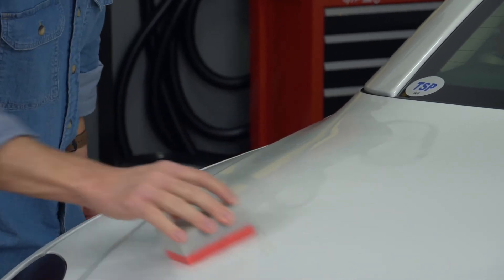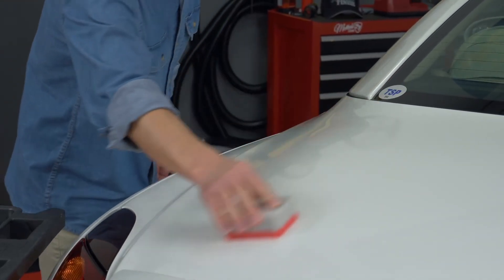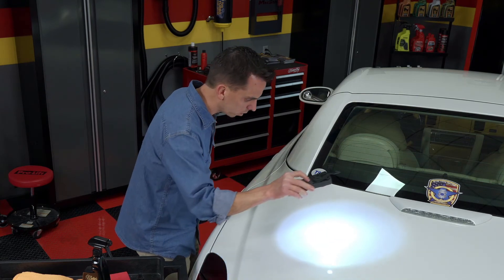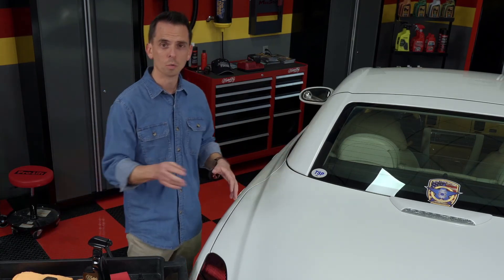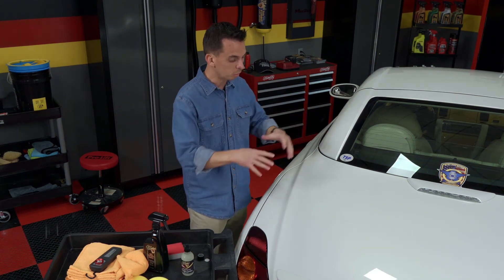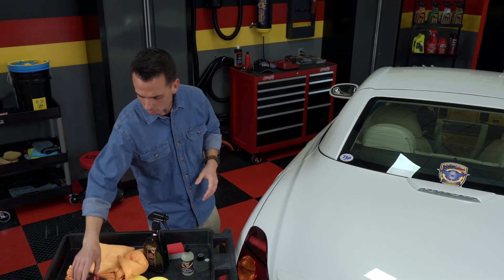Quickly coat the entire panel you're working on — work on one panel at a time. This trunk is considered two panels, and it'll make squeaky noises; that's normal. Make sure you're working in a well-lit area. If you don't have adequate lighting in your garage, you can use a light — even the flashlight on your phone — but this is a specific detailing light to really see where you're applying it. As you apply this up and down and then side to side, you'll notice a rainbow effect. The rainbow effect is the coating flashing, which means the carrier agent is essentially evaporating away, leaving behind the nanoglass graphene ceramic particles that fill in all the pits, pores, and valleys to create that perfectly smooth, water-fearing, glossy surface.